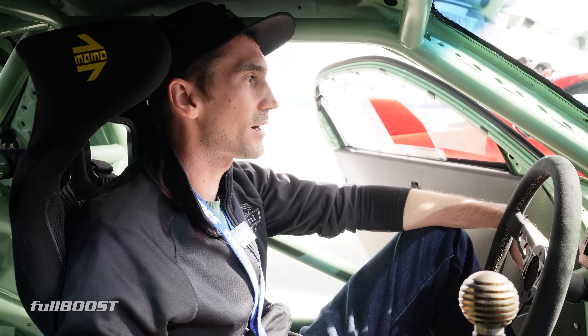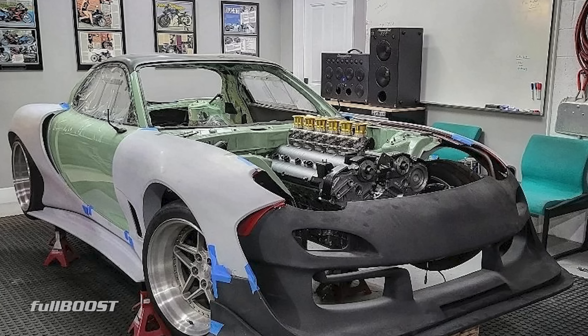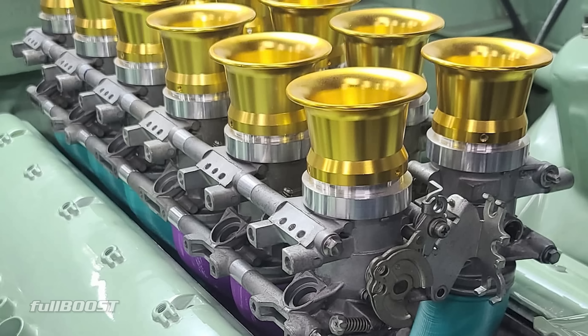So tell me about the new setup — what's the deal with the engine? Yeah, so the car was blown apart, sold the motor, trying to figure out what to do. I did an equal length manifold six-to-one for an S600 Mercedes, and when we did that we bought a mock-up block. We had to go back and forth building those headers, so yeah — it's the M120 V12 Mercedes platform. There's really no aftermarket support for it, but Pagani used it in the Zonda and they sound amazing, so we made it fit and made it work. In the process we kind of developed a lot of M120 parts. With an LS you can go in a catalog and buy the same part from 100 different companies, but the M120 has really no aftermarket support, so we developed a long rod setup — our own rods and pistons.